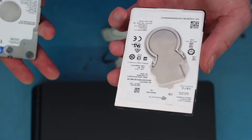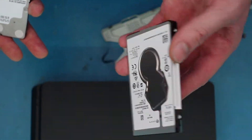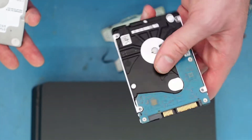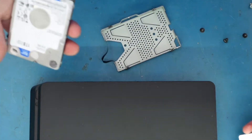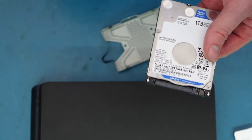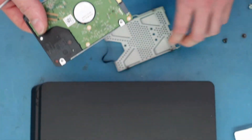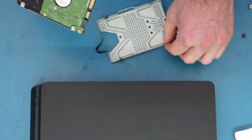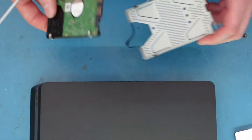This is actually the original drive that came with it — this was the bad one that was in there. It's a Seagate Rosewood drive. We actually have lots of videos talking about that for data recovery if you're interested. If you have data on there, that's going to be a little different story. But we already replaced it. This is what we replaced it with — a one terabyte mechanical drive. These are a 2.5-inch drive, so if you're not sure. And if you have a 2.5-inch SSD, you can put that in as well. We recommend Samsung or Crucial ones — those are pretty good.